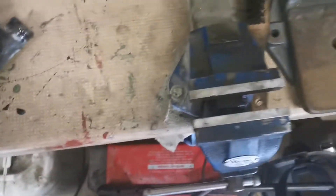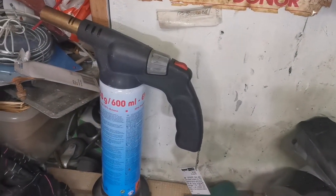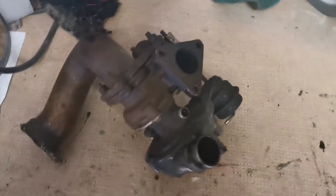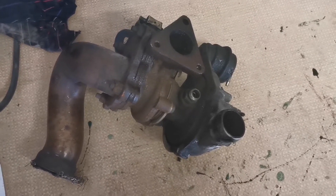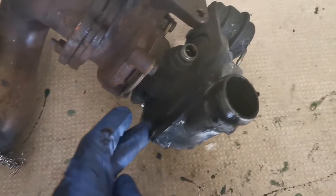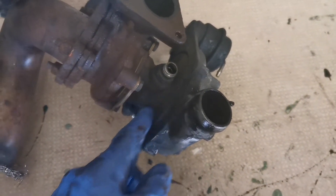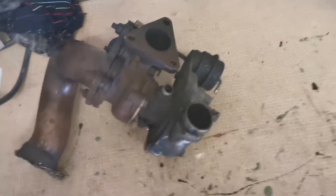What I need to do first is get the turbo in my bench vice and get those four fairly rusty-looking nuts off. I have my old trusty friend the gas torch there, and I have a funny feeling I may be needing it. Some judicious use of WD-40 — not the best penetrating oil in the world, but it's what I have. Then I need to take a set of four bolts around there that come out of the turbine plenum, and the compressor housing has more bolts around there as well, so they come off, and then that leaves you with basically the centre housing with the back plate for the compressor — the shroud support, we'll call it — so that's the next on the plan.